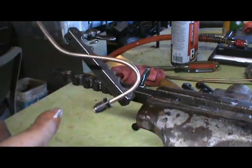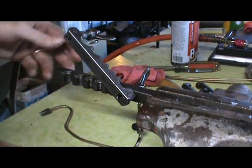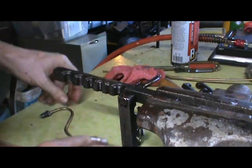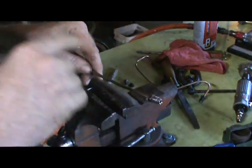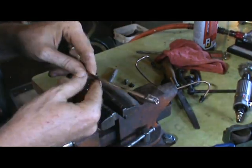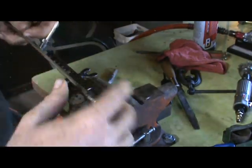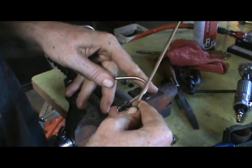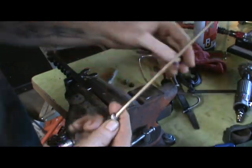I would just duplicate this on the bench, but mirror image it — flip it. But I want to go ahead and show the video of how I get all this work done for those who have never done it before. I decided to do this before I head back to the car because it would be a little easier to do at the bench. I know about what bend I need here. I went in, pulled my fitting down, and I just imagined the center of that bend — I've got it roughly there and marked it with a marker.